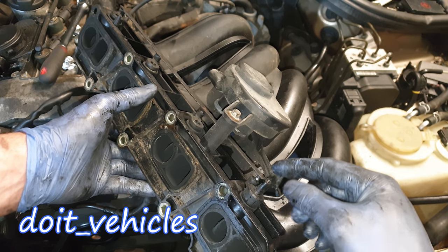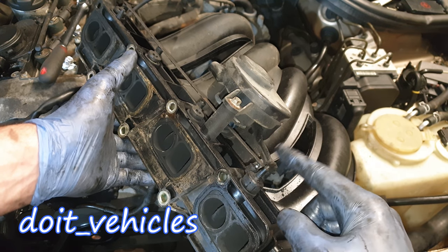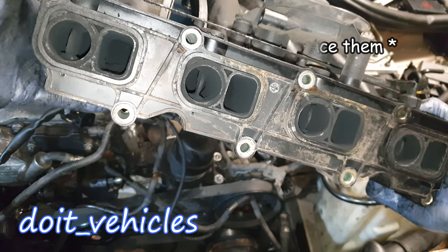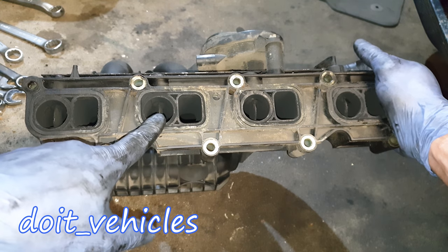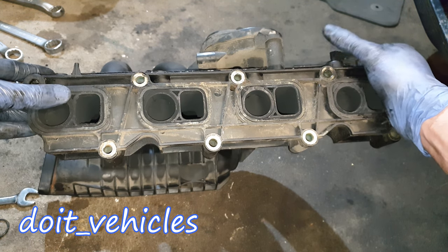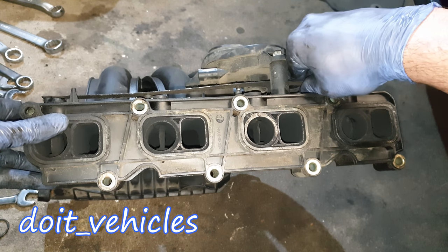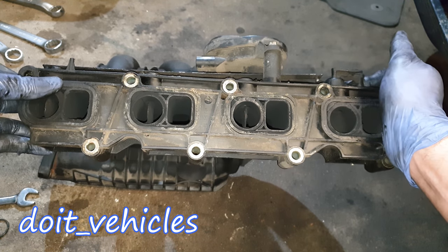In my situation I found this link disconnected from these two flaps. If this link is disconnected then only one will work — make sure you've got a good connection here. More importantly, check for carbon build-up because in my situation there was a lot. If you have a lot of carbon build-up, these flaps are going to get clogged and you won't be able to close or open them.